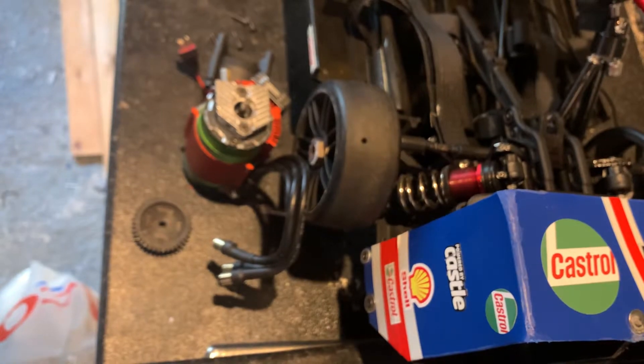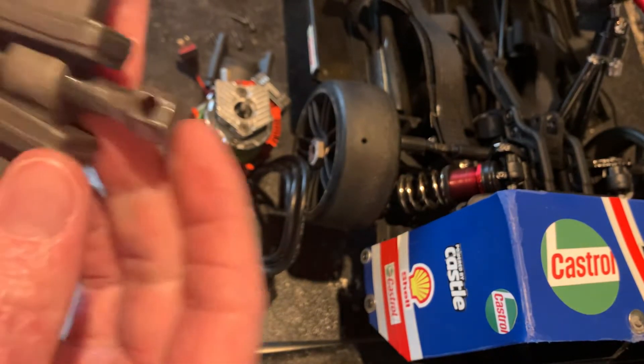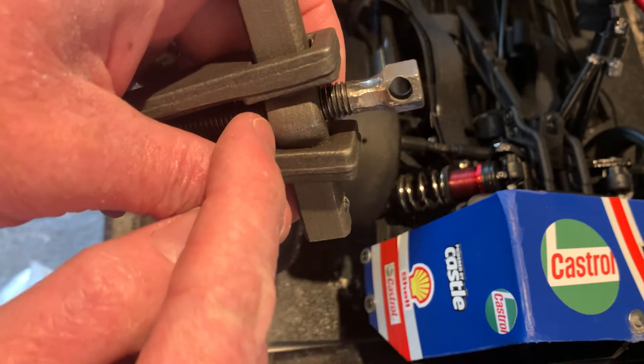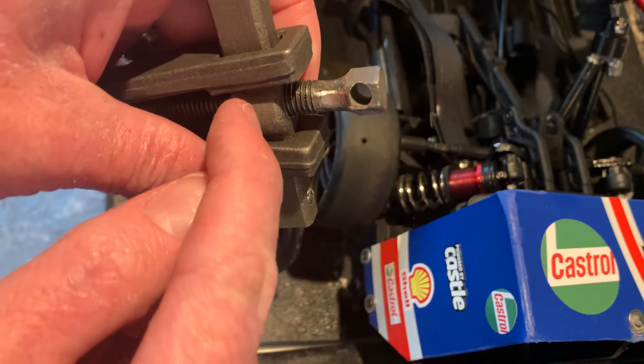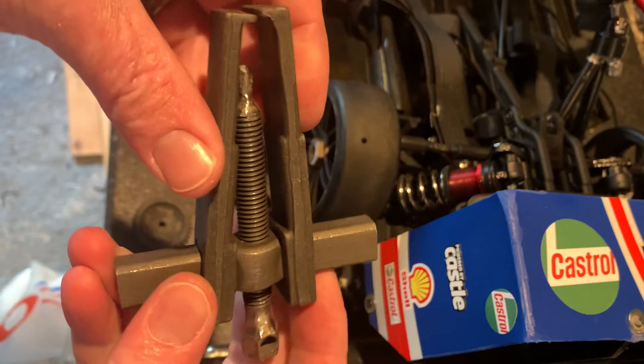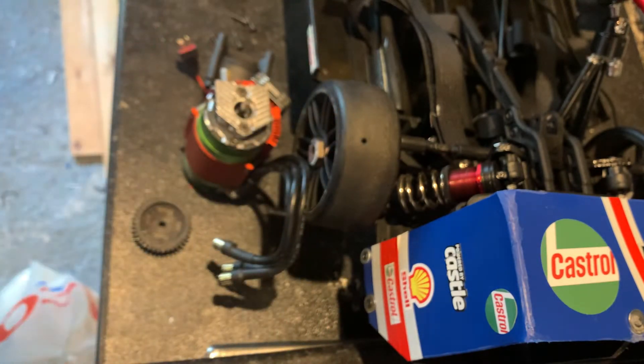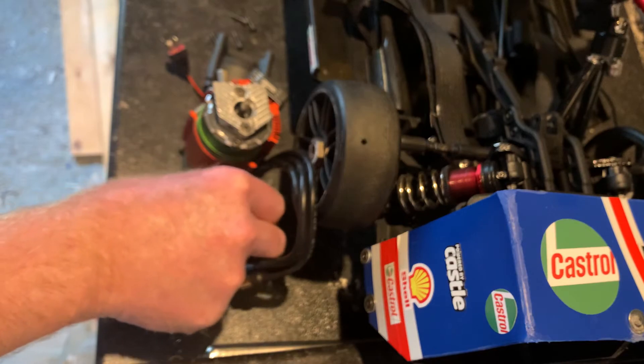Hub puller — eBay. I'll maybe attach the link where I got it on eBay. But obviously you have to modify it: I ground it down a bit more up here so it could screw further in. I drilled down in here to take some of the threads off so it can screw further in. And I ground that down a bit more in there so it can be pushed further into the shaft. That is what I will be using from now on.